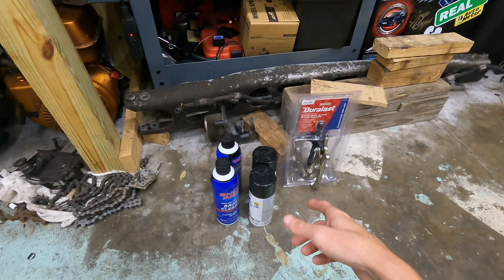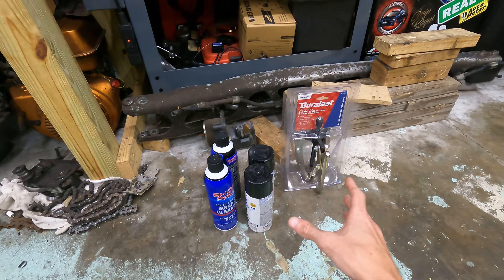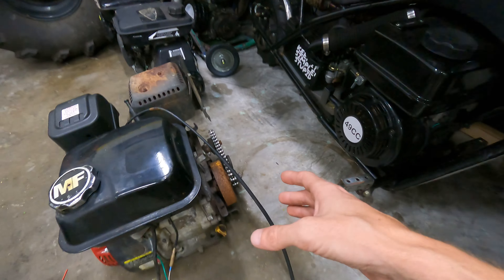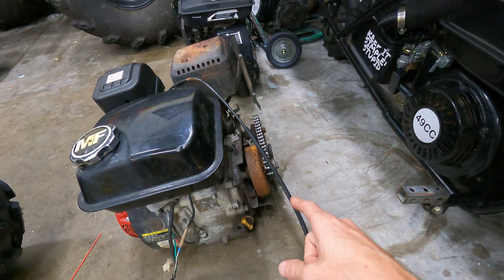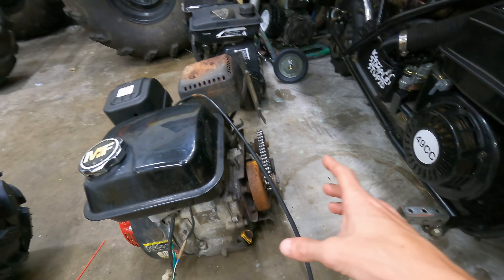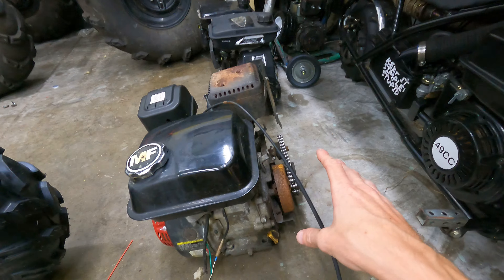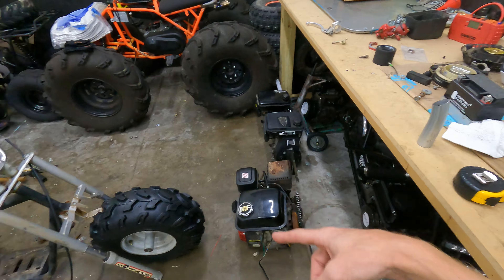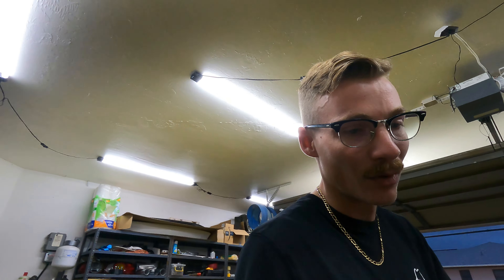Since it's raining, I'm just going to strip this motor down as much as possible and knock out what I can. I picked up some brake cleaner, a three-jaw puller, and some black paint so we can clean up the motor and get that clutch off. I definitely want to take my time because I really don't want to mess up the crankshaft at all. Hopefully it comes off smoothly after some WD-40 soaking in there. Then we can replace all that dual chain setup, slap on the new clutch, and have a fresh motor ready to roll.